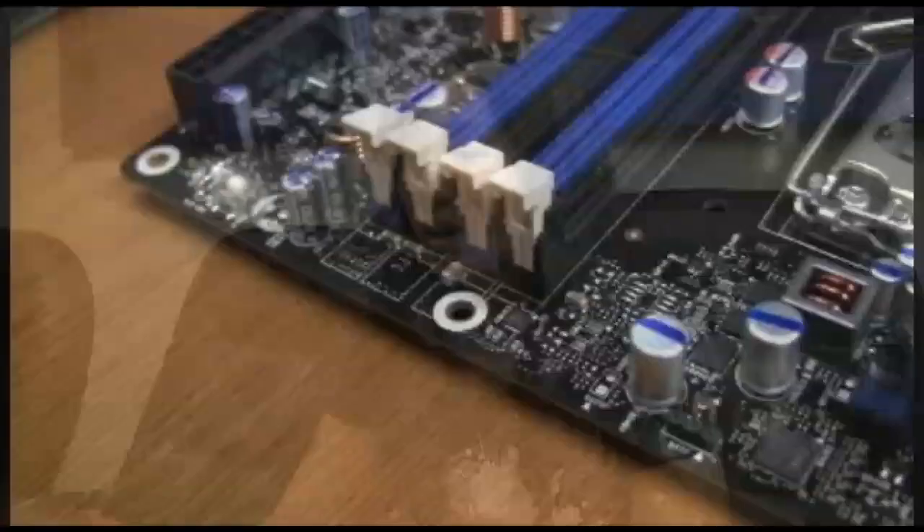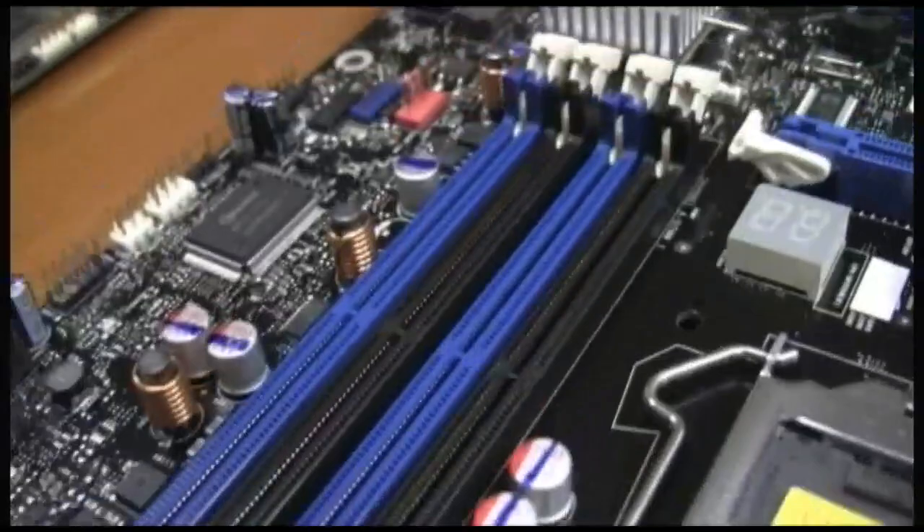One more question — memory native support, how fast? So the CPU on the support side is 1333, but these three boards, because of the overclocking capabilities, we are claiming 1600 or more. Our engineers internally have gotten it up to 2400. If you pop in a 1600 megahertz DIMM and select XMP, it'll automatically run at the right latencies. That's what I consider native — you pop it in with nothing more than a click and it'll run there. So native 1600 and then everything else is gravy.